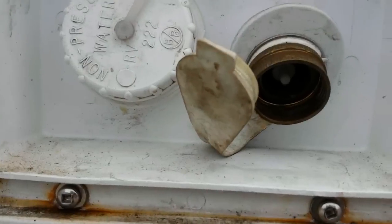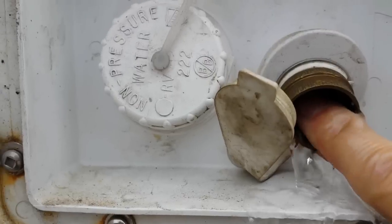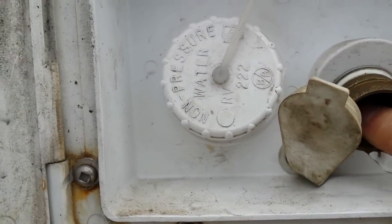Because of all the headaches I had, I forgot to film me draining the faucet. So just like I did with the toilet, you keep the pump on while you're drawing antifreeze out of the container. Turn the cold water on and wait until it runs pink, then turn it off. Then turn the hot water on, let it drain all the water out of the pipe until you see the pink fluid coming out. You also want to release the water pressure for the city water — there's just a little button in there — and just let that run out.